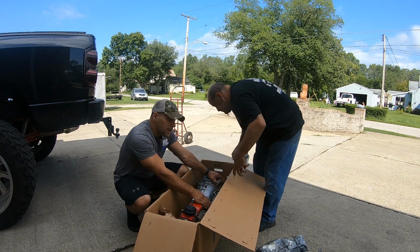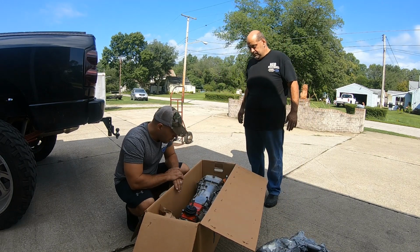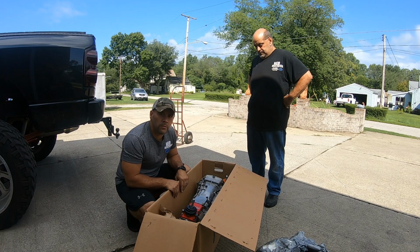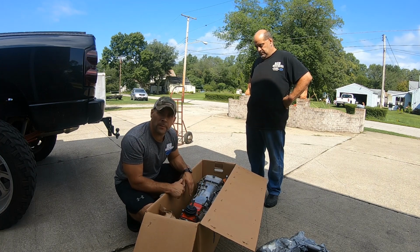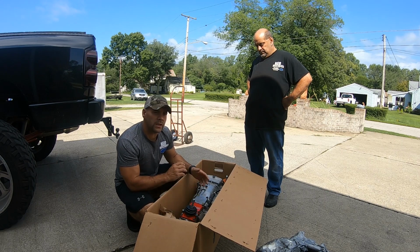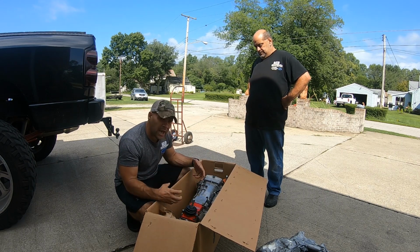Bob Hanlon has kind of preached to me and coached me along over the years, and a faceplate will make it shift guaranteed, but it'll also make the trans a little weaker, if that makes any sense. What's good about synchros is they slow the gear down, so they slow the impact and the engagement of the teeth.